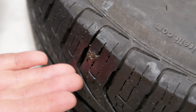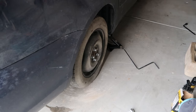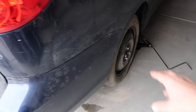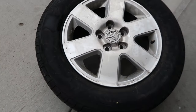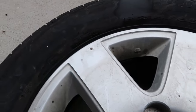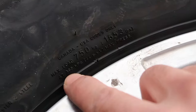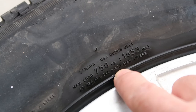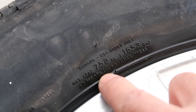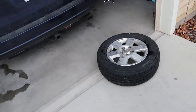Fill it up, and you can double-check with some soap again if you're worried about it, but I've never had that problem. As a little bonus info: I put on the spare tire rather than put it back because I'm going to put it on the front. When you're filling it up, some people don't know this, but the tire pressure is printed on the tire itself — it's one of the smallest numbers. You can see the max load in pounds, and right under that it says 44 PSI max pressure — that's the number you're looking for. They really need to make those bigger to help people out. Best of luck on your repair!